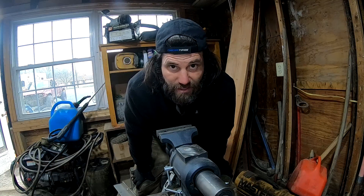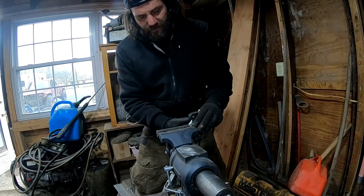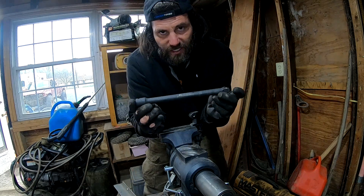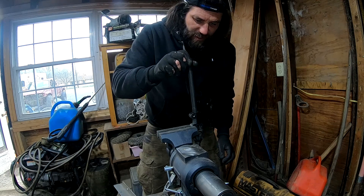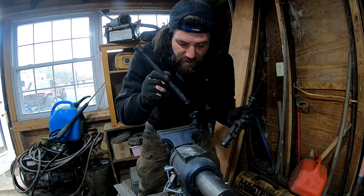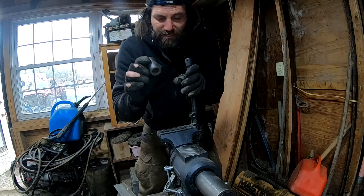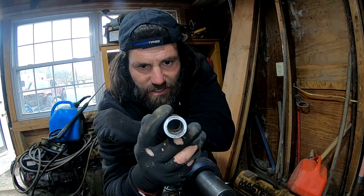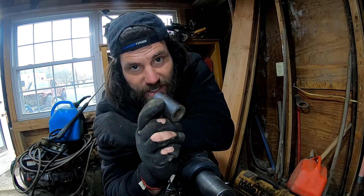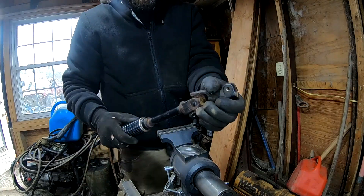All right, I'm over here at the workbench, got my vice here — this is my good steering shaft, I'm going to clamp this right here in the vice. I figured out that this half-inch extension fits snugly down in there. I'm not going to weld that in place, but I'm going to use this to line things up. I can slide it down over the other piece too. I also found this little guy — it's just the center of a bushing, basically a metal spacer, and it's just about the right size and length.